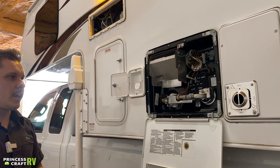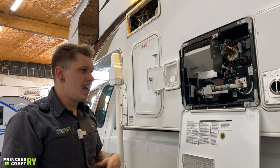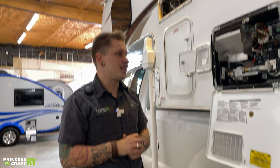We have your Atwood Dometic six-gallon water heater here. This is a dual-source water heater — it runs on 110-volt electricity as well as propane gas with 12-volt direct spark ignition. Running it on both sources gives you the highest recharge rate at something like 17 gallons per hour. Standalone propane is around 15 gallons per hour, and standalone electricity is 11 gallons per hour.